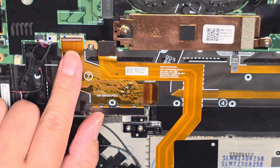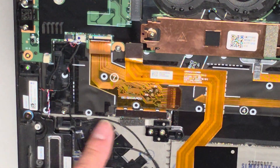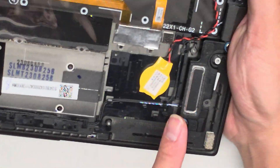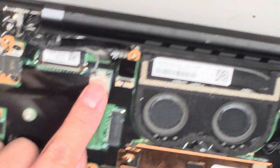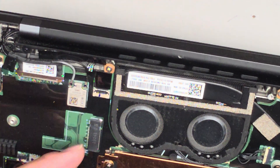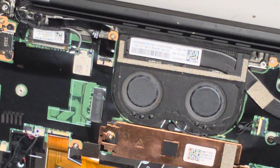There's a little flip latch mechanism here — you flip that plastic piece up and then pull the cable out, though I'll leave that in. There's a cable going to the speaker on this side, running around to the other speaker as well. The wireless card is soldered to the motherboard. If you want to remove the antennas, grab from the tails and pull straight up. And this connector here is for the power button — it has a flip latch and there's adhesive holding it as well.